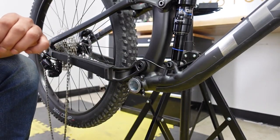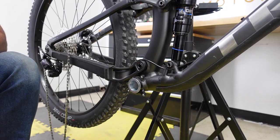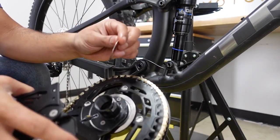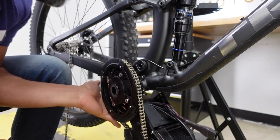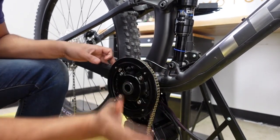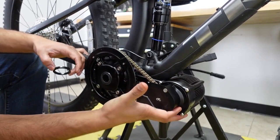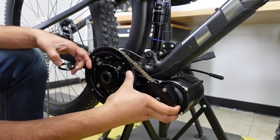CYC comes with a packet of grease in the kit. Depending on which bottom bracket size you have, those are the spacers you'll get — this one came with two half-millimeter spacers. These go on the drive side to prevent the chain ring hitting the chain stay. We dry fitted this motor and it needed the two half-millimeter spacers, and the five-millimeter spacer goes on the non-drive side. After you have the motor in the bottom bracket, turn it up and make sure you have good ground clearance.